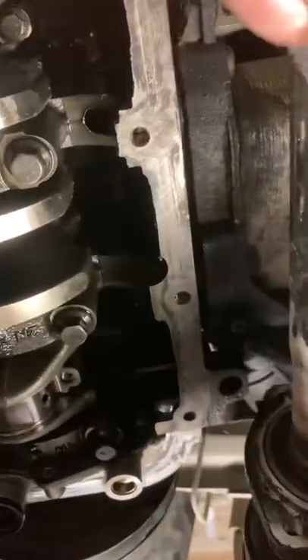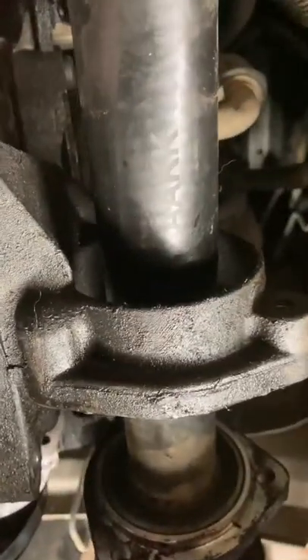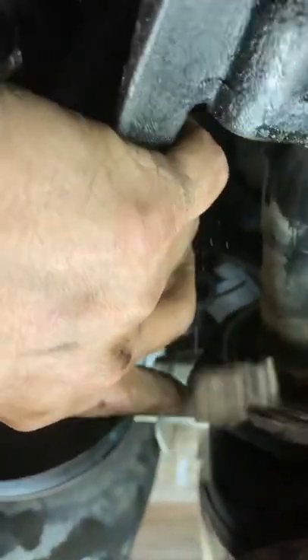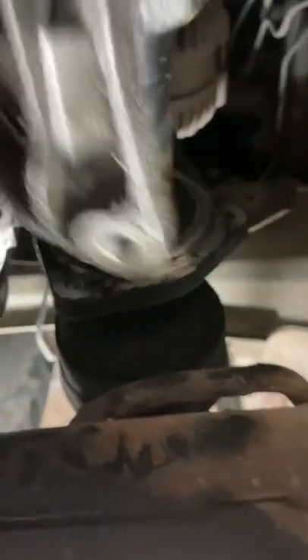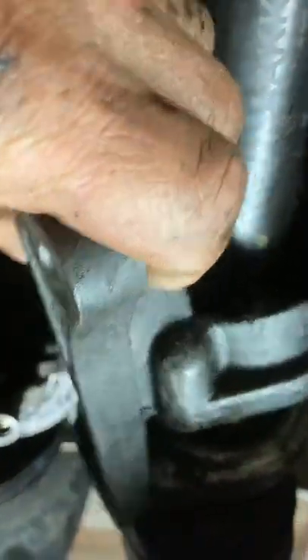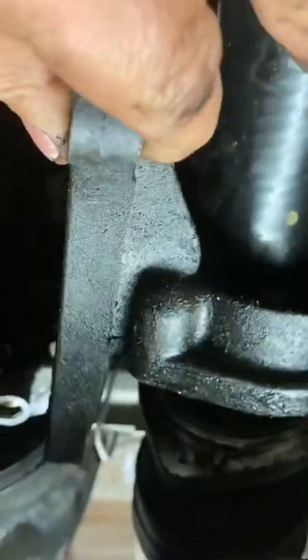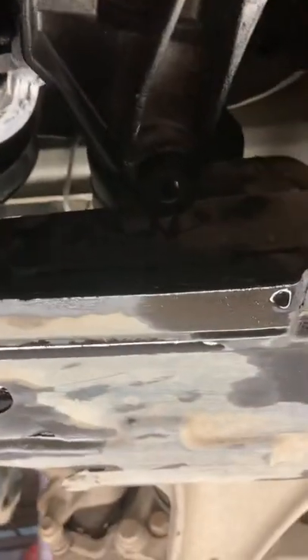You don't actually need to take the drive shaft out. What you have to do is, that sits up on the sump like that. You have to take the drive shaft carrier out — you take the bolts out of that, and the three bolts out of this. You can't actually take the three bolts out of this unless the carrier's off. So you don't actually need to take the hub off, which I did, then put back on.